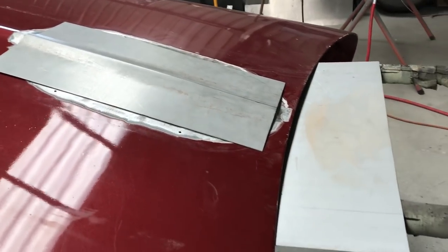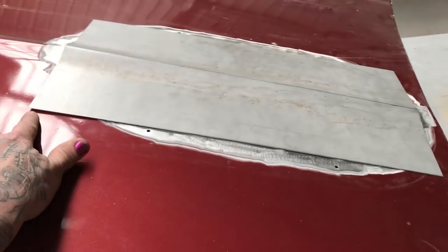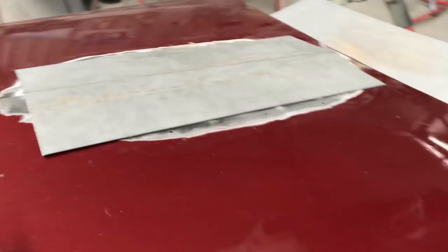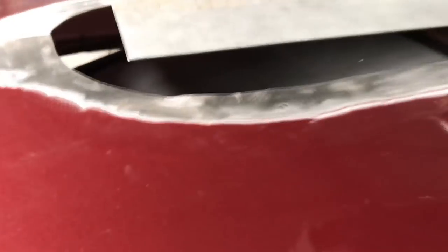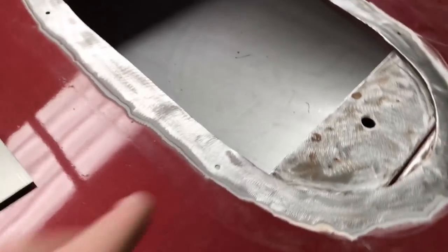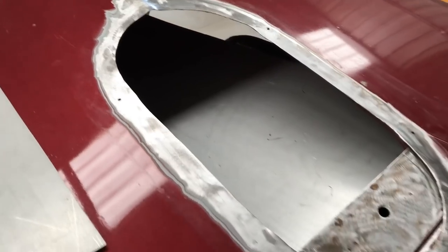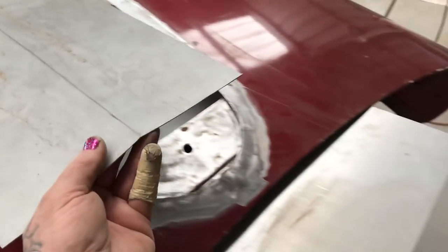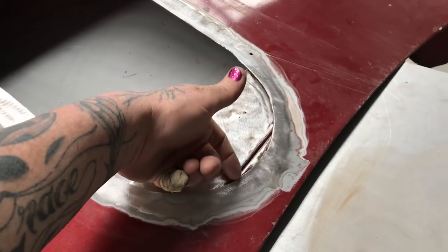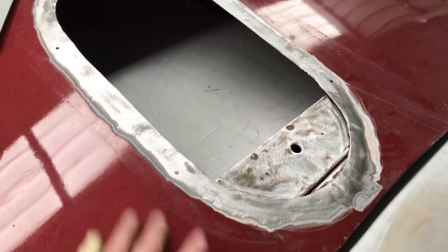There's our patch just sitting on the bonnet. The bonnet has a bit of a curve in it - I've actually curved that a little bit just by bending it. It's sitting up a little bit because the edge has got all dings and it's wobbly. The next thing I'll do is hammer and dolly up this edge, then use the grinding disc to clean up these corners, and then we can transfer the shape. I'll trace most of it from underneath, and I'll make a cardboard template for this section where I can't get my pencil inside.